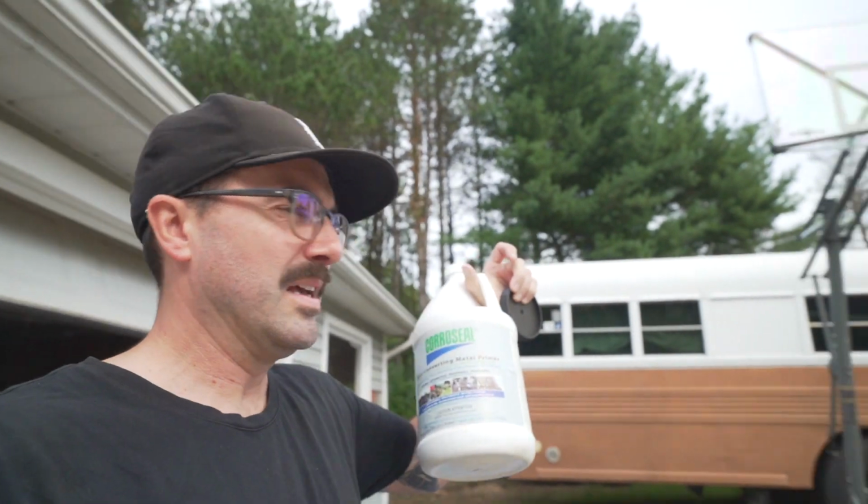New day, new mustache. I needed to shave. And continuing with roof prep, I'm gonna spend the morning using a product called Corroseal. This is incredibly helpful if you ever find yourself in any type of bus conversion. This is a rust converting metal primer. So not uncommon when bare metal gets exposed to start to get a little bit of surface rust. And the great thing about Corroseal is that it takes that surface rust and literally will convert it into a black primer that can be painted right on top of.